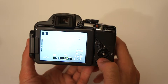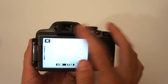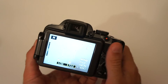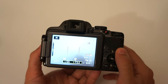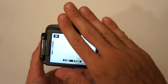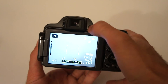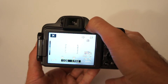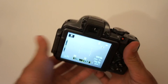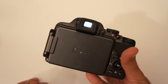There is also a detail that is quite strange on this camera. It uses an electronic viewfinder, but there is no way to select it manually. For example, some cameras have proximity sensors so when you put the camera to your eye it automatically switches to the electronic viewfinder — this is not the case with this camera. And if you push the display button, it does nothing but change the layout on the LCD. If you want to use the electronic viewfinder, the only way to use it is simply to close the LCD.